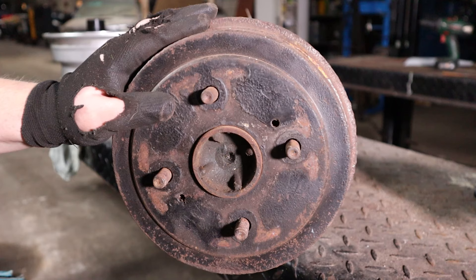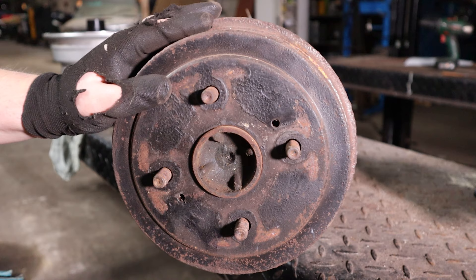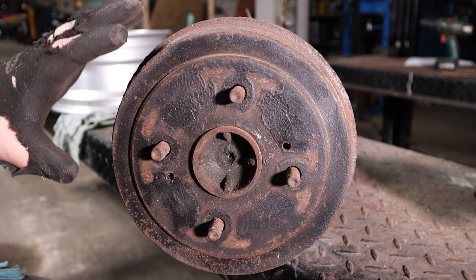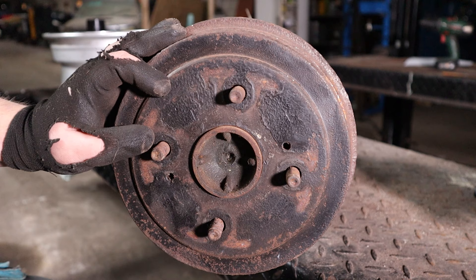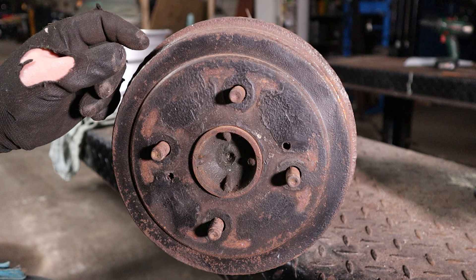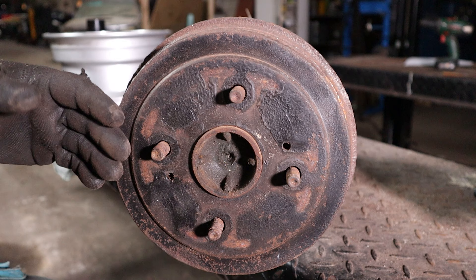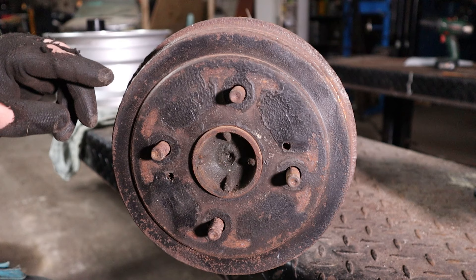I ordered a couple of setups — some different calipers, some different discs — and I did find one combination that is probably going to work. Too bad it is not from the same car, and that makes things a little bit more sketchy. One of the reasons is that the caliper I've got is for a 20 millimeter wide disc and the disc that I've got is 17 millimeters. Not that it is that big of a deal in this case because it's only three millimeters, but consider that if the brake pads get worn, the piston is coming out three millimeters more than it should. That of course can cause a problem of the piston popping out and then we have leakage and no brakes at all. I don't think that three millimeters is that big of a deal.